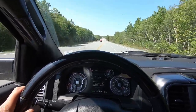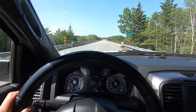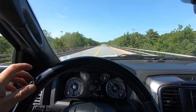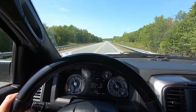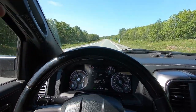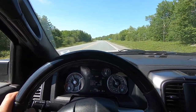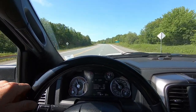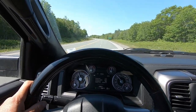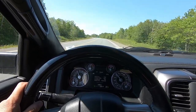The Ram will use the exhaust brake but it won't downshift. People in my videos before said get that checked out, it could be something with your tuning — but that was my first Ram, my first Cummins. This is the second one and so far it's the same thing — it just won't downshift going down hills. Guys out there, especially PD Diesel Power — that'd be the guy to talk to, he's had so many of these Rams, especially the fourth gens — do you actually have to tap the brake to get the thing to downshift, or what's the scenario here?